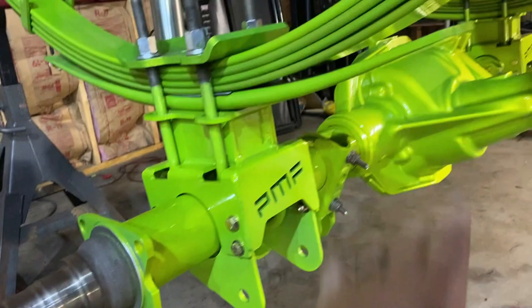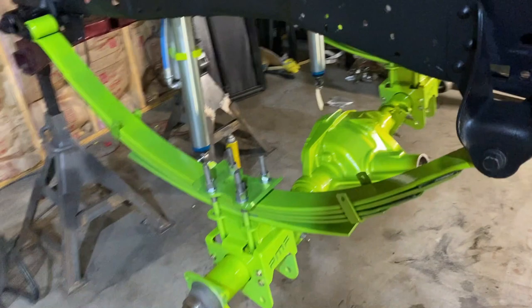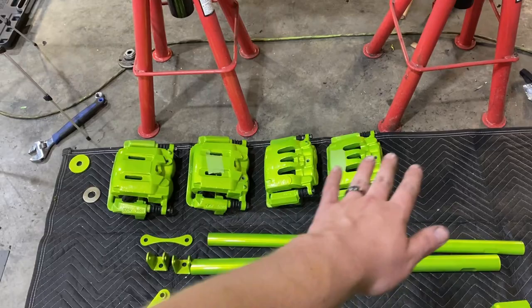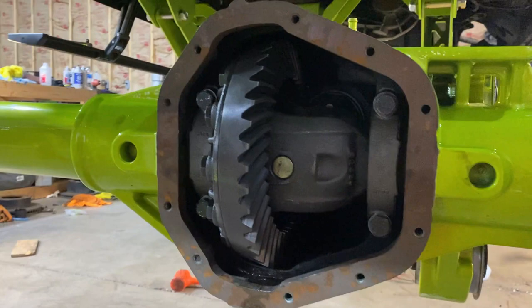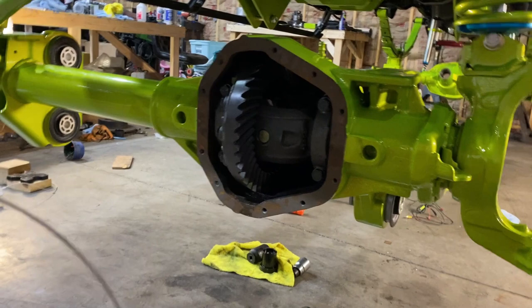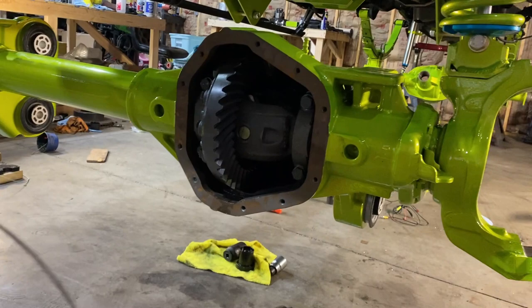That's pretty much all for the rear. We've got the leaf springs on, U-bolts, everything. The rear is coming along. We just need those bottom bolts for the rear shocks, and then the rear is pretty much done except for actually assembling the axle itself. Moving along to the front, we have got a lot done up here. We have our King stickers on the reservoirs, our billet clamps on the reservoirs, our coilovers in and tightened down. We've got our calipers together ready to be installed. We went ahead and reassembled those. We've already got the gears and everything installed — I just have to set the pinion angle depth tomorrow. The shims and stuff I reused from before, so that should be fine.